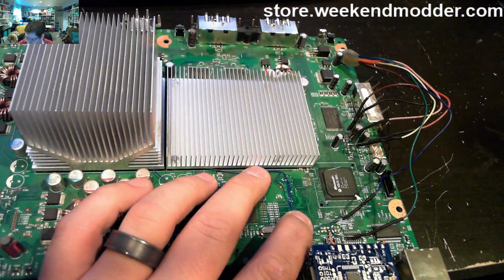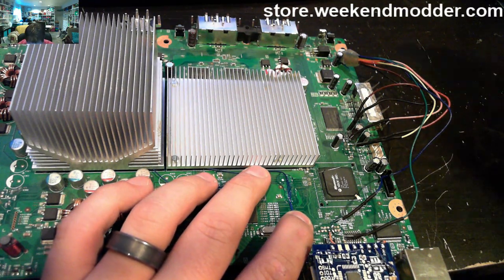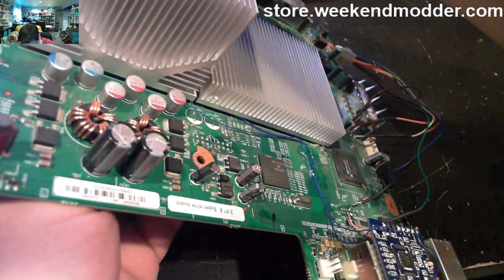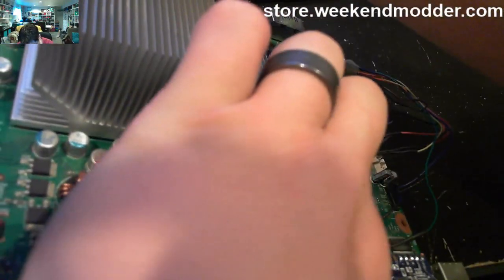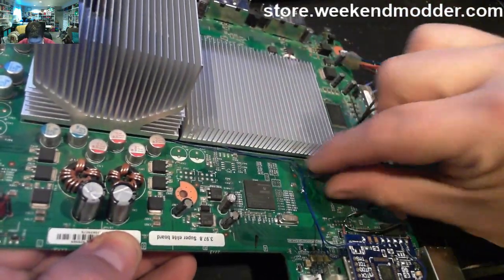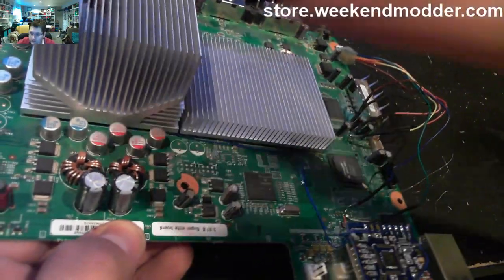And then I'll pull it from the bottom side again to bring it taut so that there's a nice straight line from the chip or AV housing over to the heatsink, and then a straight line following back over. So as I pull it right through, that glue was still a little bit wet, so it wanted to pull out a line there, but that's still real nice. So it's straight up over to the heatsink, and then straight over to the through holes, avoiding our problematic areas.